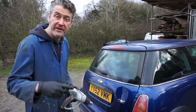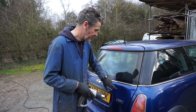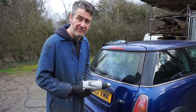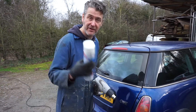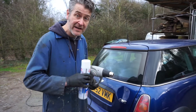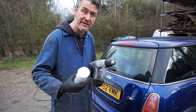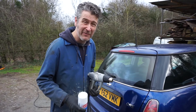There are loads of videos about this on the internet. We're going to try and get this dent out using a hot air gun. Everybody uses compressed air, but we're cheapskates, so we're going to use anything with propellant in - we're going to try it with the ISO. We heat up the panel so it expands, and then you rapidly cool it. The theory being the dent just pops out of the metal and goes back to its original shape. We'll see if that works or not.